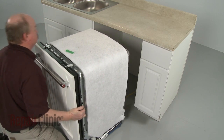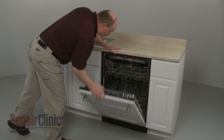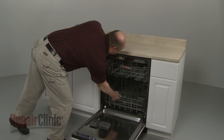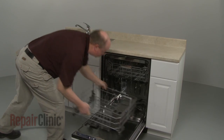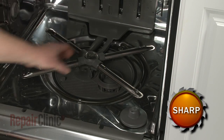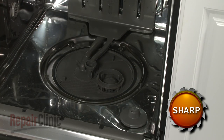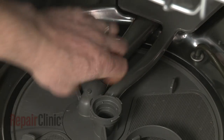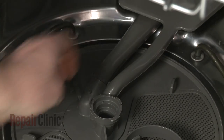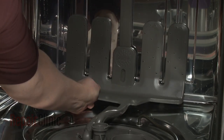Before you do this, we recommend removing the pump cover and diffuser at the bottom of the tub to ensure the diverter motor can be properly reseated during reassembly. Rotate the lower wash arm locking nut counterclockwise to release the arm. Detach the manifold inlet tube from the pump cover, then lift the manifold up and pull it forward to remove.